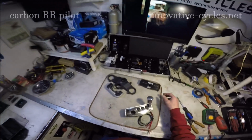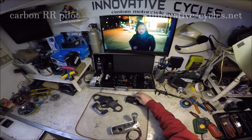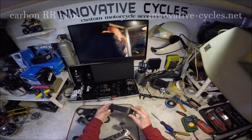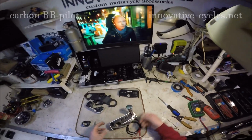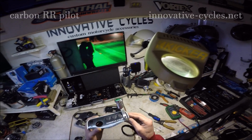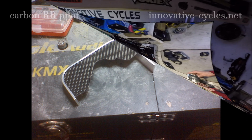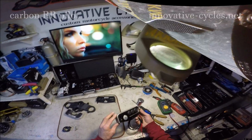And on my CBR, I had quite a few little gizmos even back then when I first came out with my mirror kits. I had a set of mirrors on it, fan override, tag flipper, alarm LED. So I had quite a few things I needed space for. So it worked good. I was making them out of the ABS plastic, and then I eventually started using the carbon fiber. Then I was making all my little brackets, anything I needed, out of this brushed aluminum. I would grind it, feather it, and smooth it out. Eventually I started doing the back, the surround, with the aluminum. So with the carbon fiber and the aluminum, very, very nice. So this is pretty much how I make them now.